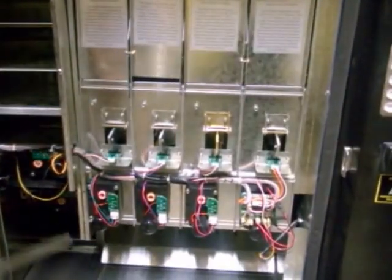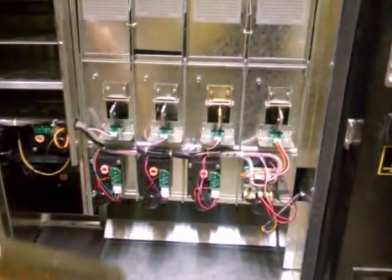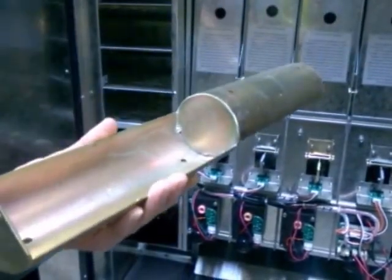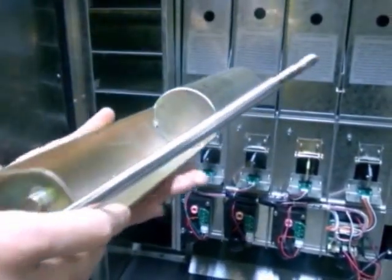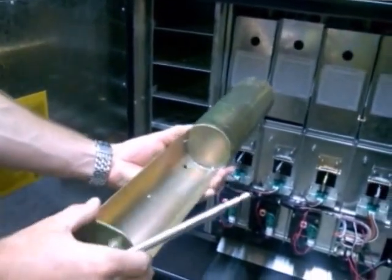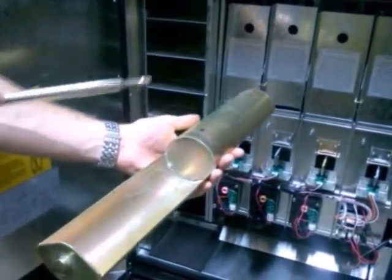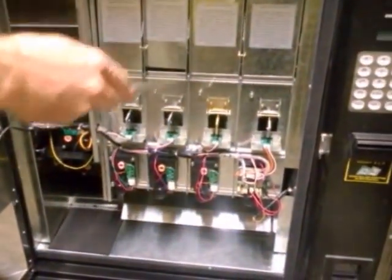That happens on only 4 motors, these 4 bottle selections. The reason that we have a 180-degree revolution on those drinks is because inside there's an auger, and there'll be a can sitting here, and then there'll be a can in the back, and there's this divider which is in front that flaps back and forth. So it's going to do a half a turn, 180-degree revolution, dropping this can or bottle out, and then it picks one up in the back, and then it does another half a turn, and it drops that one out of the back. So it drops one from the front and the back, the front and the back. That is unique on those 4 selections only.